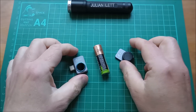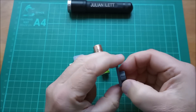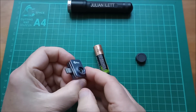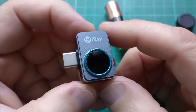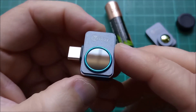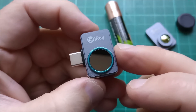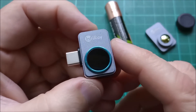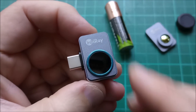It is really quite small. Also in the box is this macro lens. I'll take off the lens cover and it simply sticks on with a magnet, so it's pretty quick to put on. This is a 256 by 192 high resolution thermal imaging sensor. It's also 25 frames per second, although it doesn't do that absolutely continuously because periodically it self-calibrates, so you do see little jumps in continuous movement.